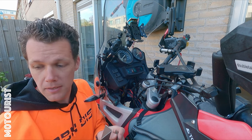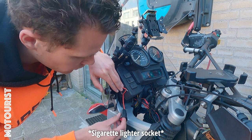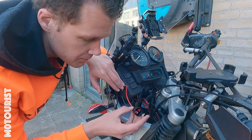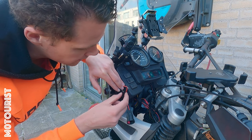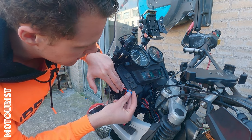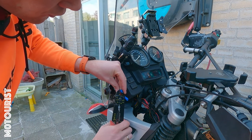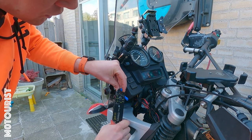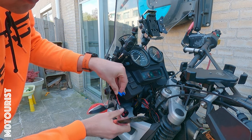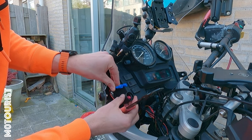Round off these corners and then paint it black. What I've just done is removed the original plug that was here. This is the rubber cap from the plug — I will reuse that. I soldered these wires together and now I will put a plug on this that will connect to the new USB charging port. The soldering of the wires makes sure that you have a good connection; you don't just rely on these plugs to make the connection. In the end it will look like this more or less.